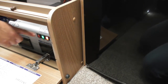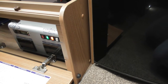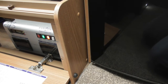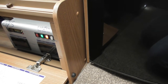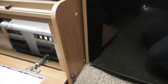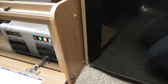Moving on down, we've got reverse polarity. So you're planning on going abroad in your van, or are you going to stick to this country? This country probably. All it is, the French and Germans are slightly backwards to us. So their positives, our negative, if you get what I mean. The power's just reversed. So if you do go abroad, that will light up to let you know there's a problem with the power externally. It won't power anything up in the van. It lights up and sort of stops the power inside there for you. So once you've remedied the situation outside, once that lights off, it is powering up the vehicle for you.